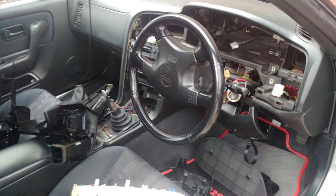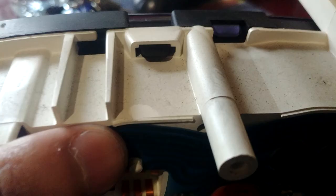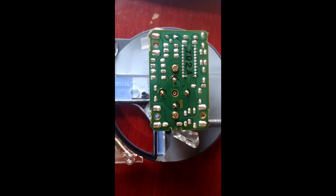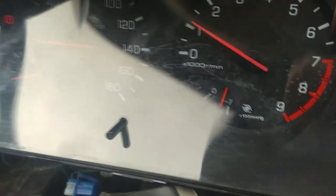It's pretty easy. You should be left with this. These are the parts you're gonna need to do the soldering. Just unclip this from the speedo fascia — that should expose the speedo. There are three screws on the back holding the tachometer on; just unscrew those and it should slide right out. Also make sure to unscrew these little ones where the speedo is. This is your PCB — this is what I recommend to solder. Then hopefully it should be working. Just reverse the steps to reassemble.